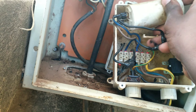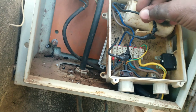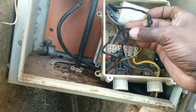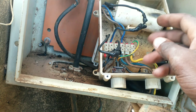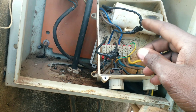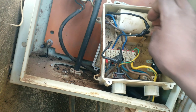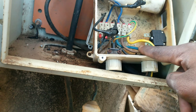The capacitor has no direction, so there are two poles. The black wire from the loading side goes through to the switch — however, I've jumped the switch here because there was short-circuiting. From the switch it loads the capacitor, and from the capacitor we have two outputs: blue and brown, which also load our motor.